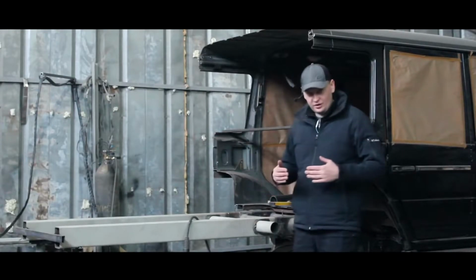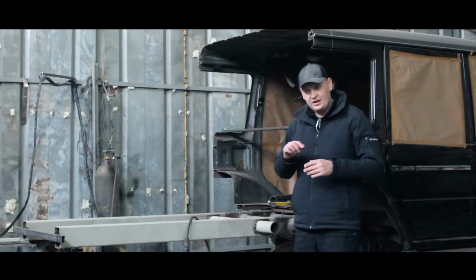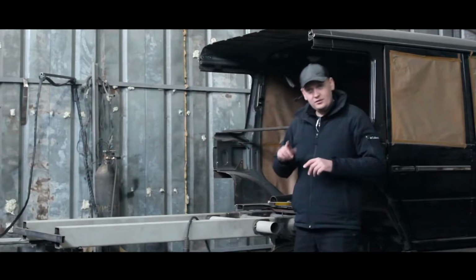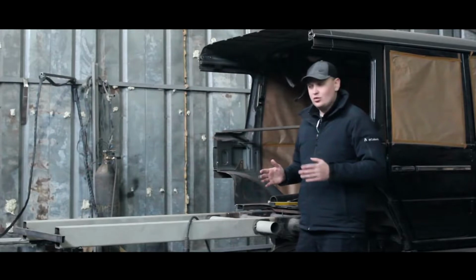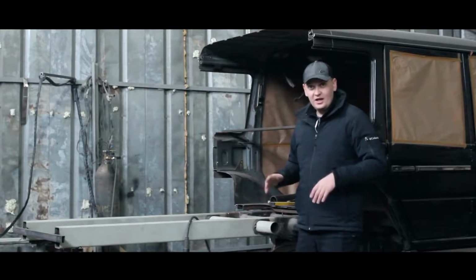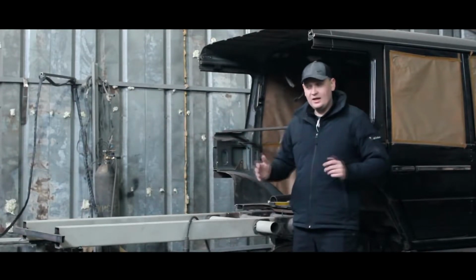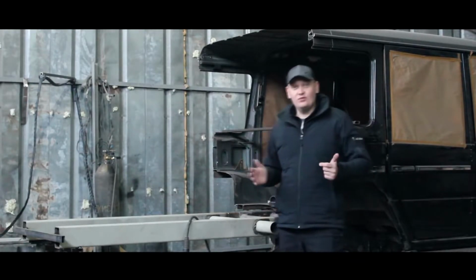In general, guys, we already have the frame ready, we can say that we lengthened the frame, welded it into the lock, that is, the frame was cut in half in a Z-shape or zigzag, I don't know how to explain, I will show you later in the video. We welded it, then we made a window, we welded it inside, because the cube has a double frame on one side, two metals, and the other side has a single frame. We welded it, in principle, there are no problems in this, but the most important point, what I told you, yes, we moved the welds back by 30 cm, as I said, that is, completely everything as the original is done. If you do not understand, the middle axis, we increased the wheelbase between the front and rear wheels, but at the same time, we didn't cut the frame in the center, as everyone thinks it is lengthened, so this is not right.